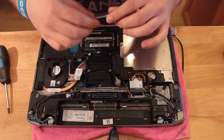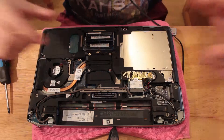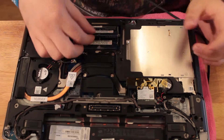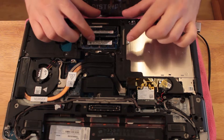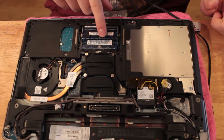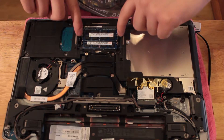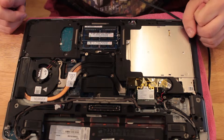Alright, so now for the cool stuff. You gotta make sure you insert your RAM into the slot. Get your RAM module, then stick it carefully in the socket. Make sure all the legs are fully inserted. Then all you gotta do is push it a little bit with your finger and wait for that clicking sound — if you hear that clicking sound, then it's in. Make sure those two metal bits from the sides grab your module, and that should be it. It's installed now.